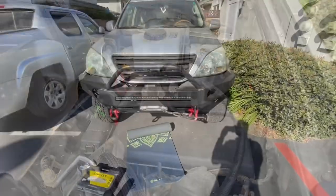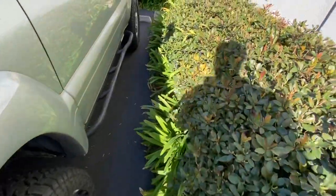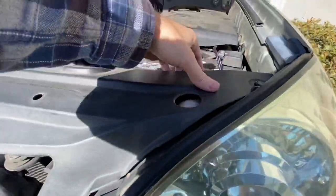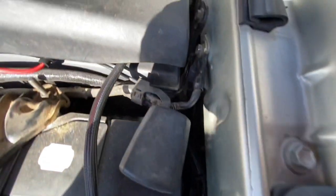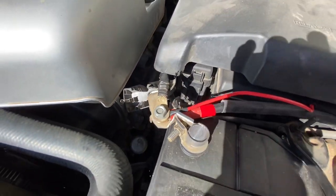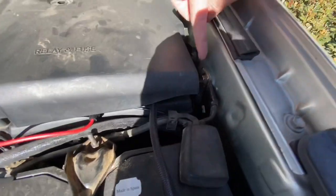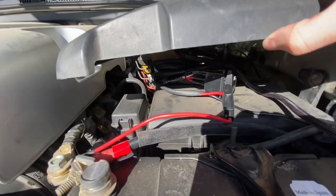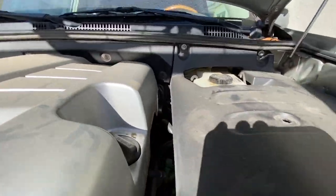Quick update - I got the winch and light bar all wired up, well not exactly all wired up, but I got them functioning. I still have to feed the wire for the light bar through the firewall. I got the lines from the winch coming up underneath and around the battery. The negative goes right there, which is super easy, and the positive goes right here. Same with the light bar - positive light bar and positive winch down here, negative light bar and negative winch stacked on top of each other. I have the wiring and switch sitting here, getting ready to feed it through the firewall.